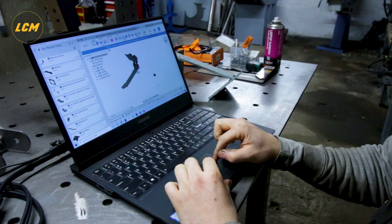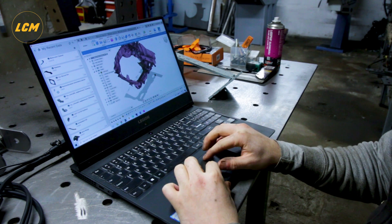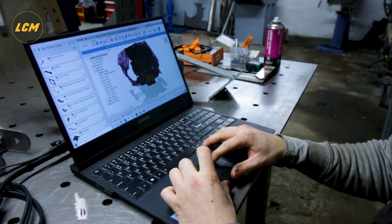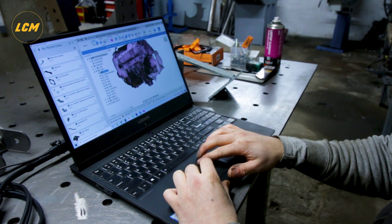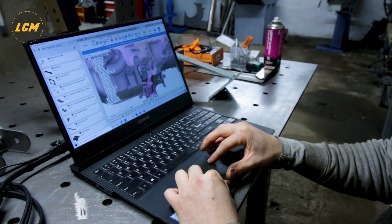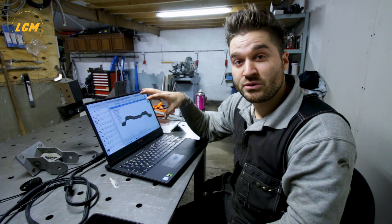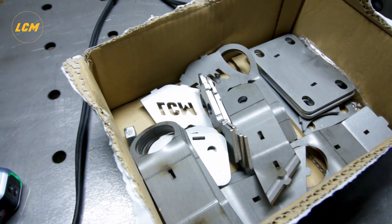What's even more awesome is that you can also do this. This here is a Volvo 240 engine compartment which I scanned completely. And you're wondering why is that engine mount there? Well, I also scanned an OM606 engine. So as you can see, this here is the engine in the engine compartment. You can literally see the oil sump here — it clears. And you can make complete engine swap kits by using 3D scans. I hope you find it very interesting because I think it's absolutely awesome, and this is really the future of car product making. You can literally try everything out on the computer, know it fits, and then make it for the car.